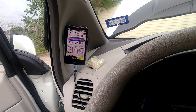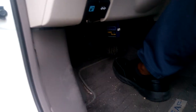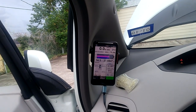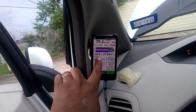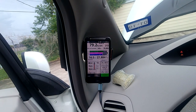Let me get the Leaf Spy working better — whenever it disconnects I have to unplug it at the back and plug it back in. So here it is getting back online. So far so good — it's charging. What I'm getting from both batteries right now is 16 kilowatts, and my state of charge is 79.2%.